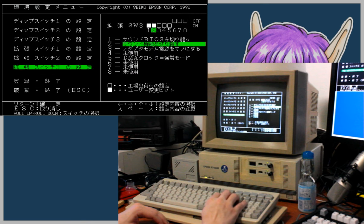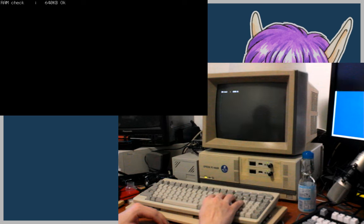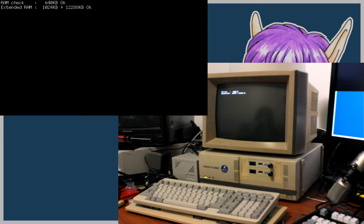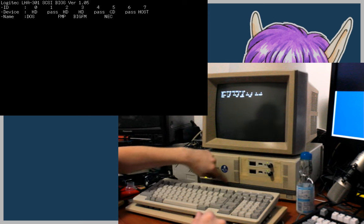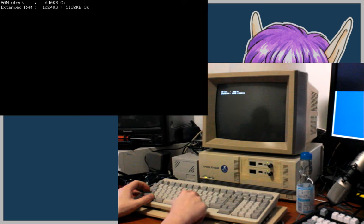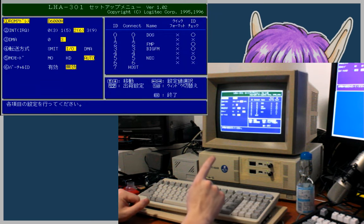And with these not set, then I use the internal sound. So, yeah, we're gonna escape from there now. And with no floppy drives in, it will boot to the hard drive, if I let it, after the SCSI controller initializes. So we're gonna do that. SCSI controller takes a while. Oh yeah, SCSI configuration, right. So Control Graph L, like I mentioned a long time ago now, it feels like. Yeah, Control Graph L brings you into this screen.